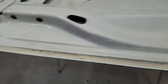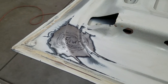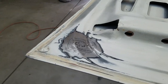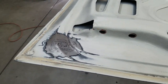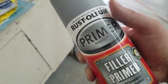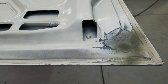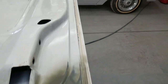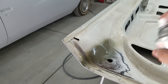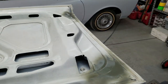These areas are already clean and sanded — prepped for self-etching primer. I went 120 grit, then 180, then 320, which is the red Scotch-Brite. Now I'm gonna spray two or three coats of self-etching primer, let it dry for about 30 minutes, then top coat it with some filler primer spray can. Just a thin coat, wait two to three minutes, then hit it again and top coat it with the filler primer.